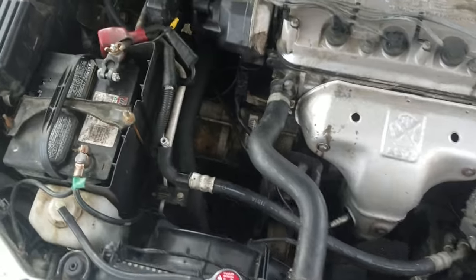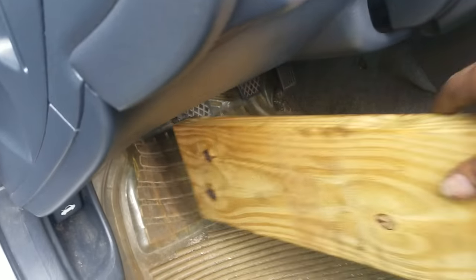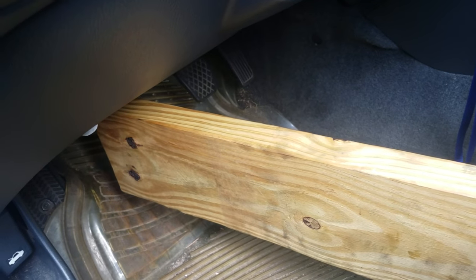After I bled the lines, I just pumped the clutch up like so. Put this 4x2 right here, and since it's just me, I moved my seat up on it to keep it compressed while I was under the hood.